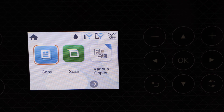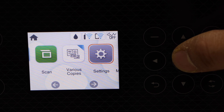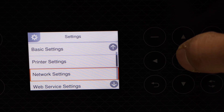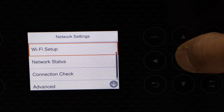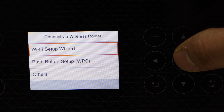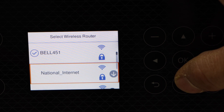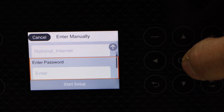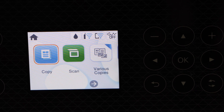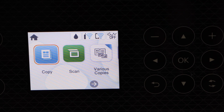Go to the home button and scroll ahead. Click on Settings, go down to Network Settings, then Wi-Fi Setup, select Wi-Fi Recommended, and then Wi-Fi Setup Wizard. Select your Wi-Fi network and enter its password. After entering the password, it should connect with your Wi-Fi network. You should be able to see the blue light on the Wi-Fi signal, which means the printer is available.